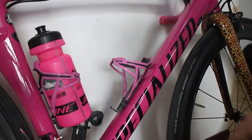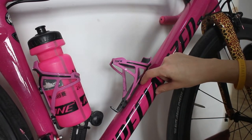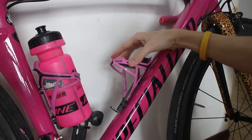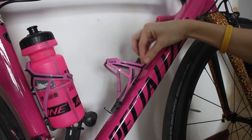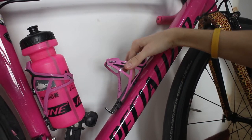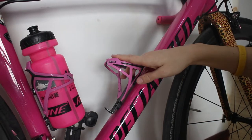What that means is it's actually the mount down here that's come loose. Water bottle cages are held onto the frame by being screwed into some bosses - or rivnuts as they're sometimes called - and over time they can come loose. This frame I've been riding for around a year and this one's already come loose. Just tightening the screw won't do anything; if you tighten it anymore it's just going to strip out the rivnut inside. What I have to do is take off the cage and go from there.